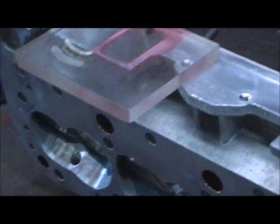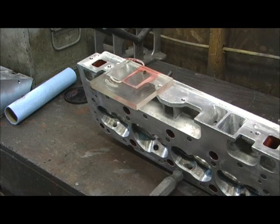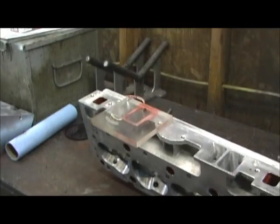I got the plate on and the grease. I went ahead and put two valves in the chamber because we're going to CC a chamber, the spark plug, and then we're going to roll it over and hit the exhaust. So we're going to record three volumes: an intake, an exhaust, and a chamber. We do need to do a chamber where I had to cut all that meat out of it to get the spark plug to lay in right, which it just about laid in right on the money.